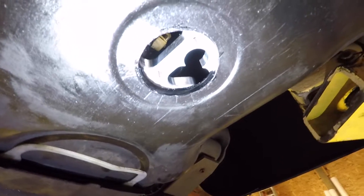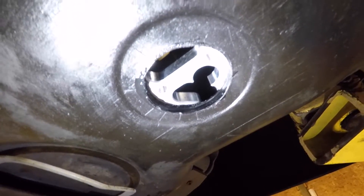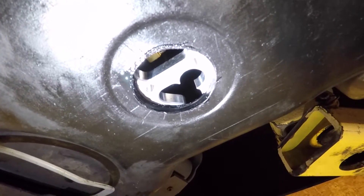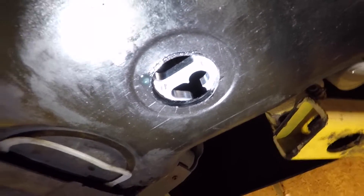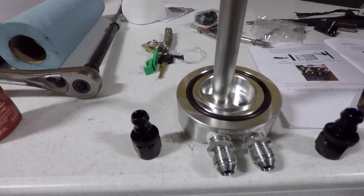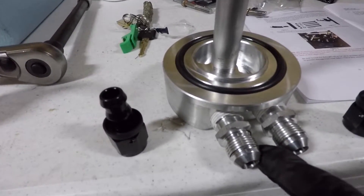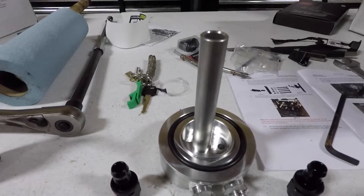We've got that part of the fuel sump in — that's the piece that goes inside the tank, which you clamp down so it pinches the tank between the bottom of the sump and the bracket. You can see it's notched out; you just pop it in one side and roll it up onto the other side. This is the billet sump from G&R Diesel. Pretty simple setup: the return line screws in hand-tight with an O-ring seal, and then you have two half-inch AN fittings with push-lock connectors so you just push your fuel hose onto it.